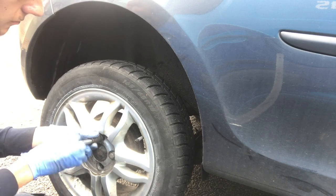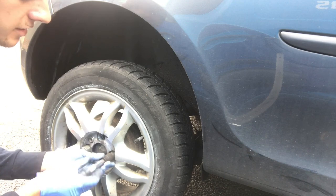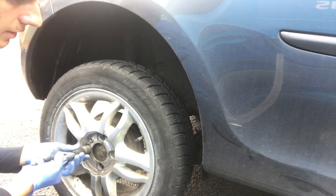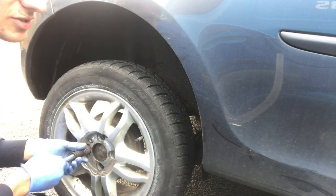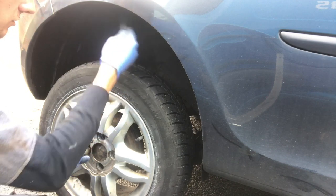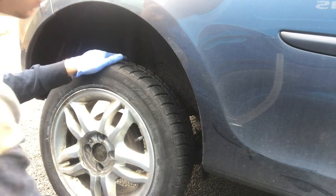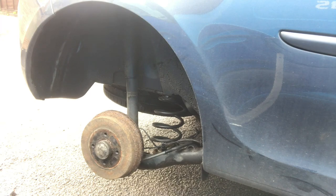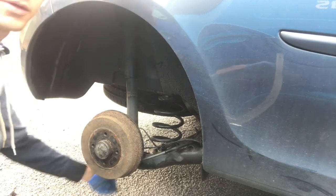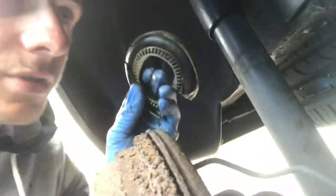When you're looking at cars, obviously cars are all different — different suspension setups, different brake setups, different spring and damper setups. But the main things you're looking out for are play in your bushes, anything that's bent or damaged, anything that's excessively corroded. Looking for rust normally along the sills, upper wheel arches — newer cars you don't see too much of that because they've gone through a better coating process in the factories. But straight away I can see — that spring has become unseated from the actual arm there. That shouldn't happen — this will need a new spring.